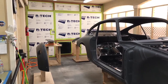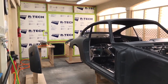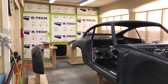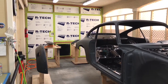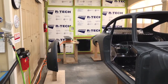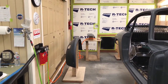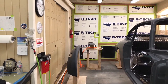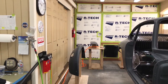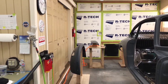Another thing to think about is when you're in the paint booth, what matters and what doesn't matter? When I'm putting down final paint, everything matters. Temperature matters. Timing between re-coats matters. Bounce back from your spray gun matters, overspray matters, what you're wearing matters. It's just an infinite list of things that can affect your final paint job. Sounds like a lot, but if you've done it a couple times, there's really not too much to worry about.